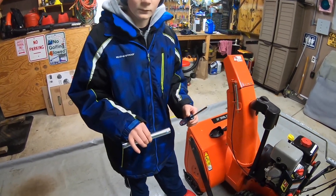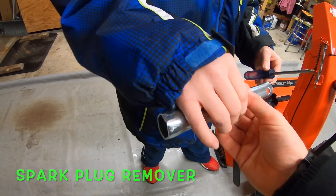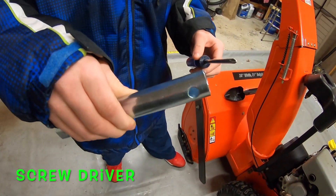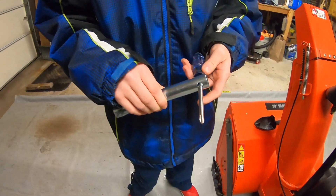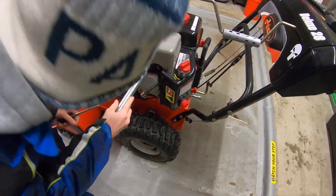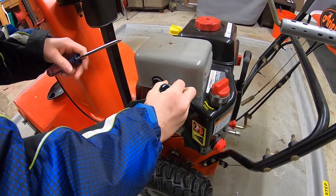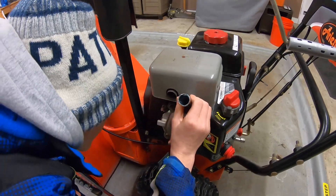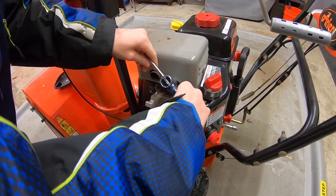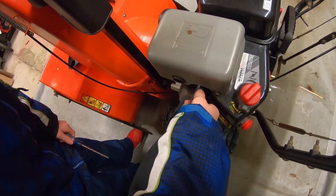We've got our tool to pull off the spark plug with. If you look here, it's got this hex bottom which is going to help twist off our spark plug, and then we have a screwdriver in the other hand. We're just going to slip it through. Why don't you go ahead and pop it on there and we can start unscrewing that thing. We slide it on real easy, he gets it on there, once he finds it's all the way on. Now he's going to stick the screwdriver through and untwist it that way, and once he gets it loosened up, he's going to twist it by hand.